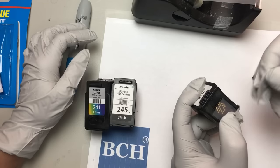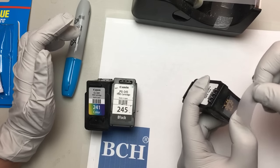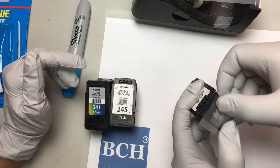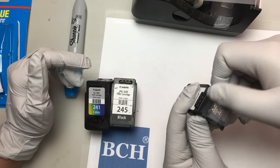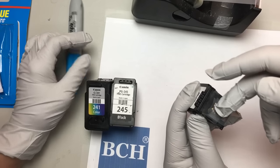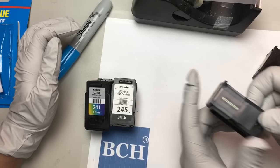Don't want to mess up the electronic ribbon because if it gets ruined, you can't use it again. We're going to use super glue. I protect it so the super glue doesn't drip down and mess up the electronic ribbon. I'll stick it a little bit higher and bend it over — so if the super glue drips down, it won't mess up the ribbon. Both sides are protected.